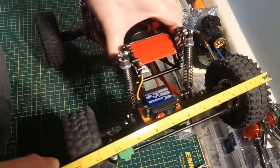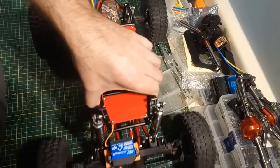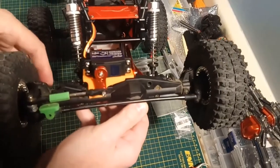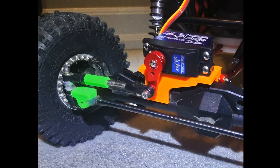This is 310mm. It would be about 290mm without those wideners. So we got the XR247 axles — they make it very wide. We got an axle-mounted servo mount, 3D printed, designed up by me.